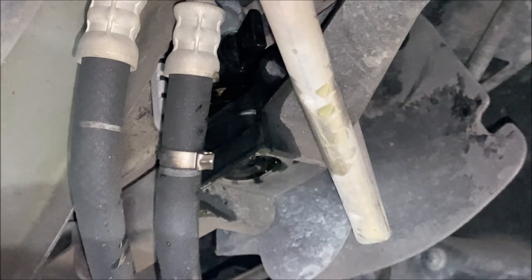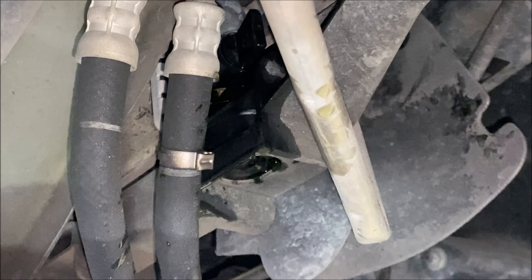I'm not sure if it's exactly the same on the other Chrysler 200s or a Chrysler 300, but I know there are a lot of models out there that have this radiator, and that's how you replace the drain valve. Pretty straightforward. It's too bad you have to drain the coolant, and now I've got to refill the coolant and burp the system and get it all up and running again. Hopefully this video is helpful. If you have any questions or comments, leave them in the comments section, give the video a thumbs up, and of course subscribe to the channel to see more content for this vehicle and all the other vehicles in the garage.